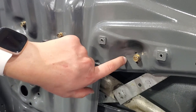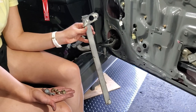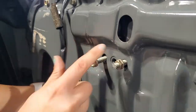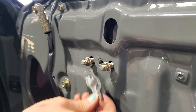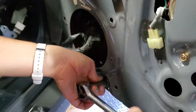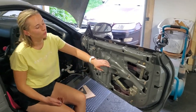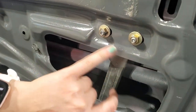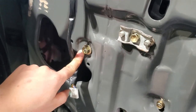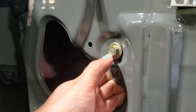The one thing to note is that this is in the proper position with the alignment tab on this side. Next we're going to be installing the left side guide. Before we continue I just want to take a moment to talk about the window alignment bolts. On the right side are two nuts that have a little allen key in the center. Over on the other side it is this assembly as well as a nut. For this style you're going to break the nut loose and use an allen key to tighten or loosen it.